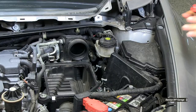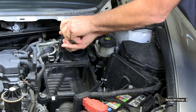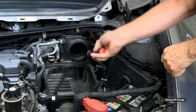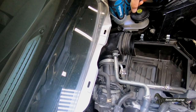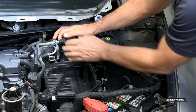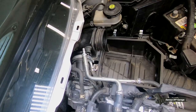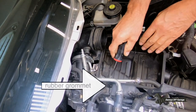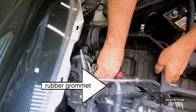And the air filter — still looks okay. Now I'm going to remove the lower air box. There's a screw here that's holding everything on, and there's also two 10 millimeter bolts — one here and one down here. That's out, and it looks like I need to get it loosened up from this. There we go — that's holding it in there, which I should just pull out.